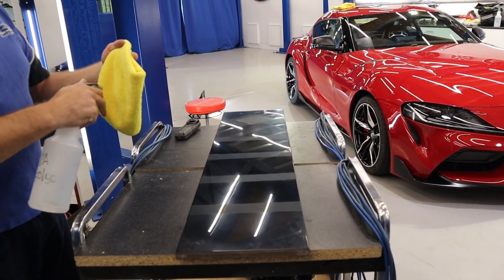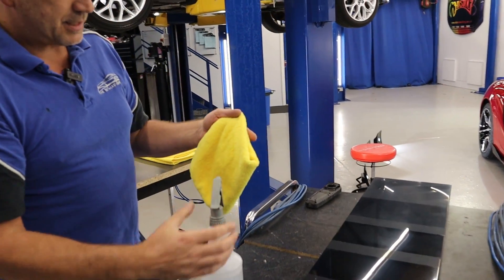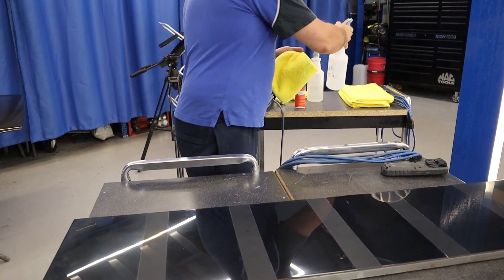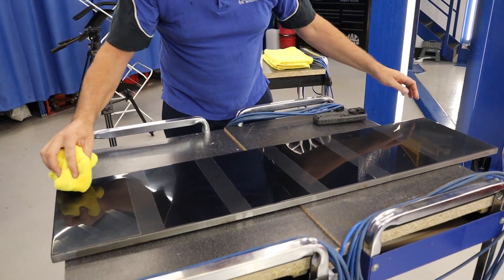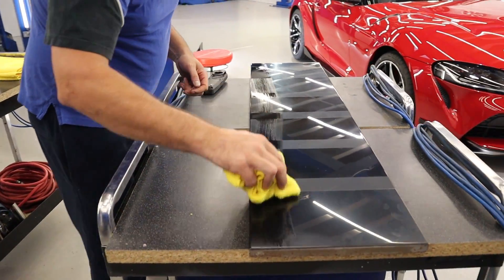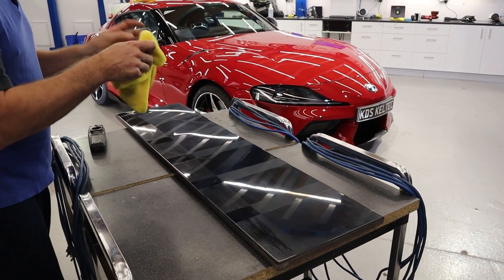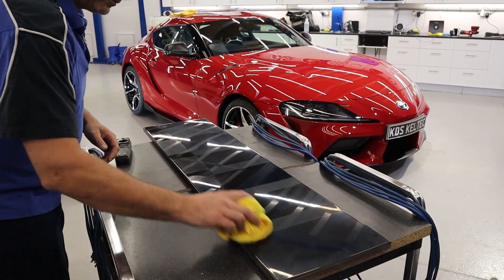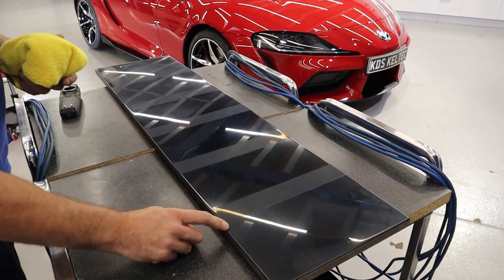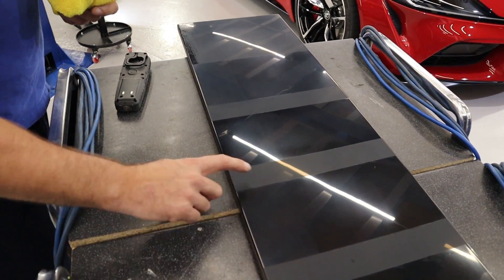A detailer's favourite: medical alcohol — 100% rubbing alcohol, this is 99.9% — mixed 50% with deionised water. This is apparently what helps detailers evaluate their work, so I'm going to do a strip through here. If it does its job, this control strip will all turn the same. You can see it's managed to remove most of the compound, but as soon as you come to the ones where there are products on top, especially some waxes, it's hardly removed the fillers.